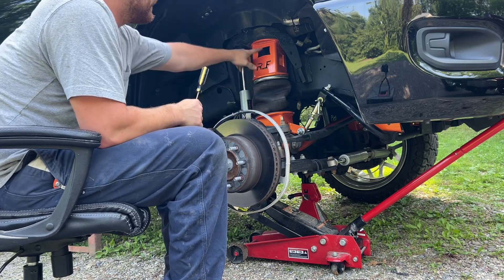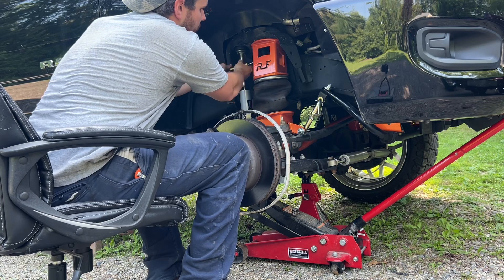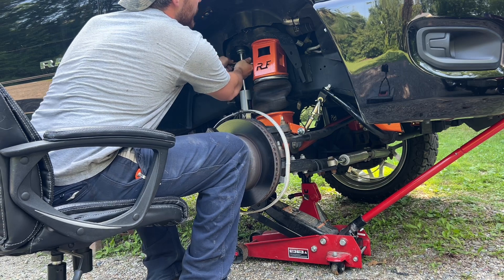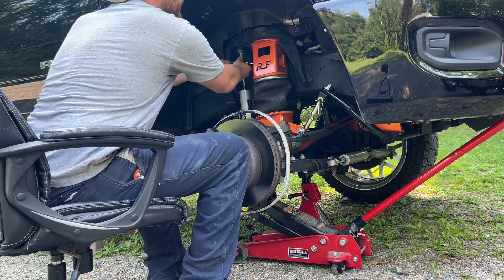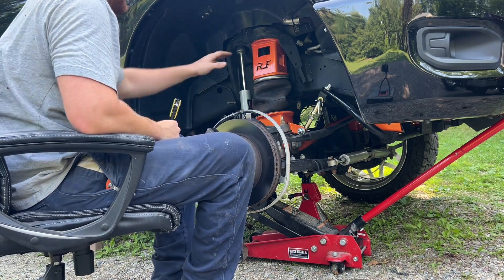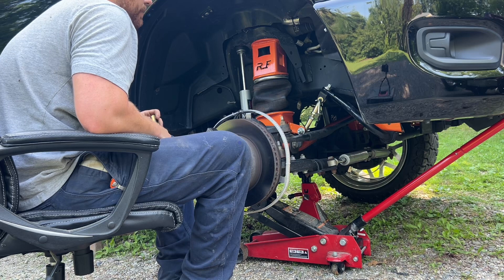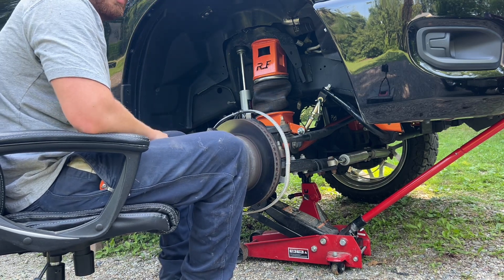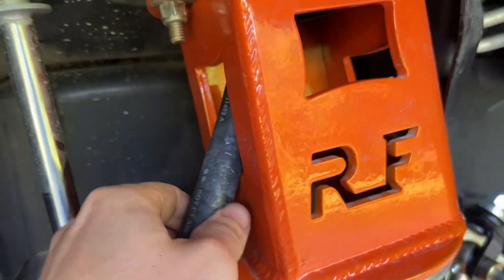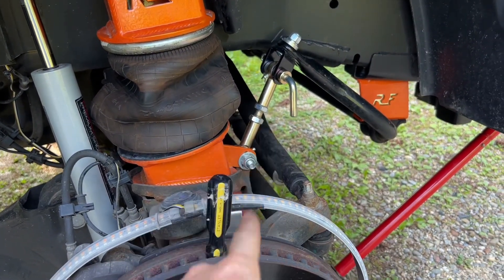The first thing I'm going to do is get this airline off the top bracket so this thing is fully separated. I use double hose clamps on this for safety and haven't had any issues with that. I did have the push connect fittings before but wasn't a fan — the angle was kind of hard here, it was kinking, and I really wasn't getting much air pressure to the front especially with how far the run is compared to the rear. So we've got this airline off the fitting.